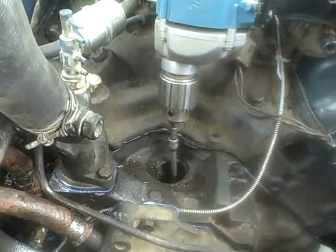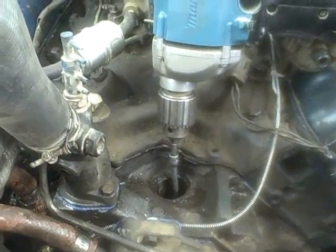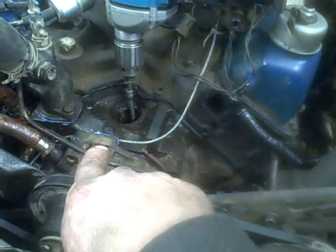Good deal — 65 pounds of oil pressure. That's really good oil pressure. You want to wait a little longer after you get initial pressure — run it for a bit more so it gets oil into your rocker arms, your cam, and all the lifters will pump up. Then everything will just come to right. Make sure you do that and once I'm satisfied, we'll drop the distributor in.